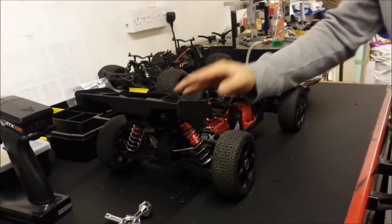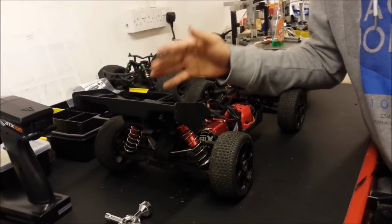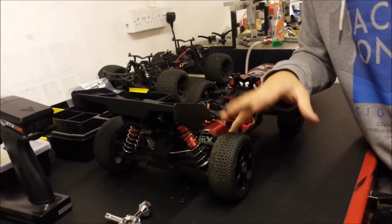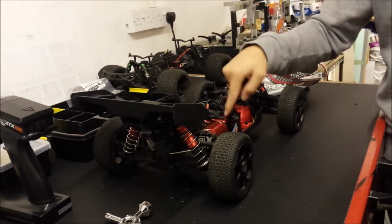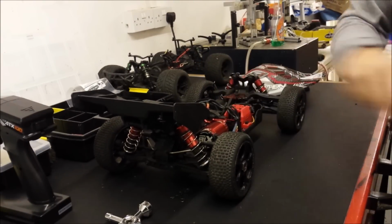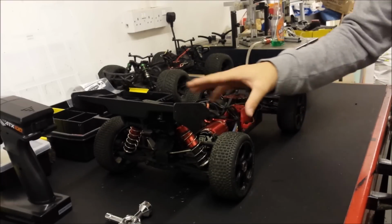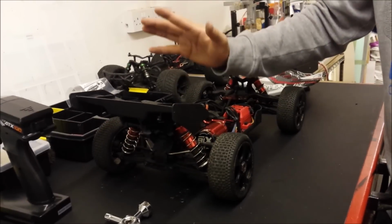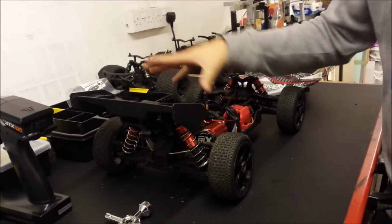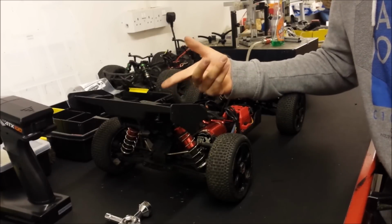I've had a few comments about this car on my channel being slow out of the box. And this is my point of view: this car comes geared out of the box with a 14-tooth pinion gear. Now in the box they include a 16-tooth pinion gear. The 14-tooth pinion gear is way under geared for 4S use. Probably if you're sticking to 4S, I would change it out for the 16-tooth pinion gear they include.